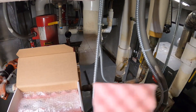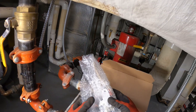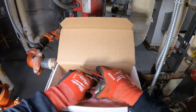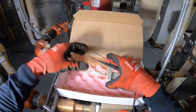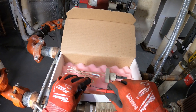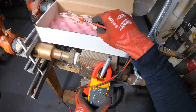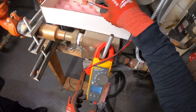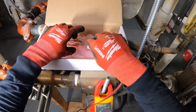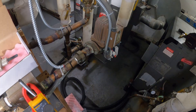I was lucky enough to find the exact OEM replacement part. What I'm going to do is test this before I install it — you have to be very delicate with these things. I want to check the resistance on the new one. The old one had 140 ohms; temperature would affect that reading. Let's see — look at that, 50 ohms! And that's what the manual said we want: 50 to 80. The other one was reading 140.